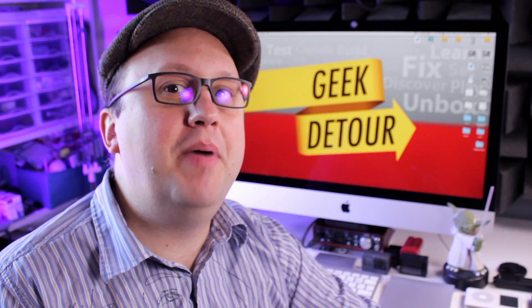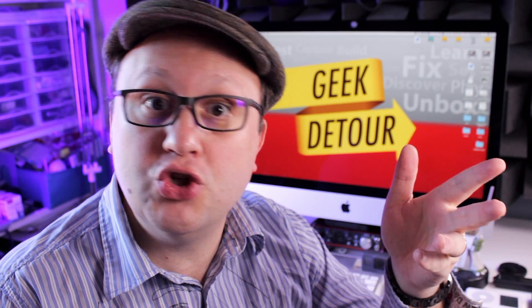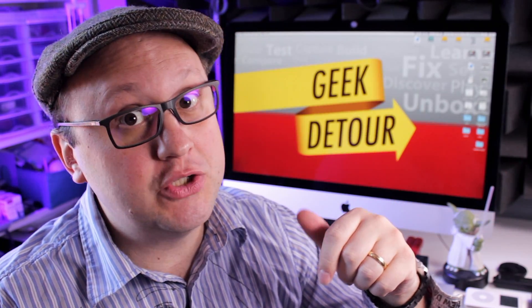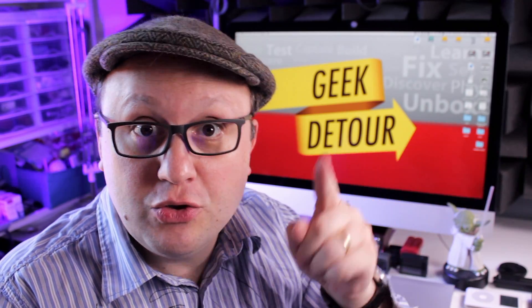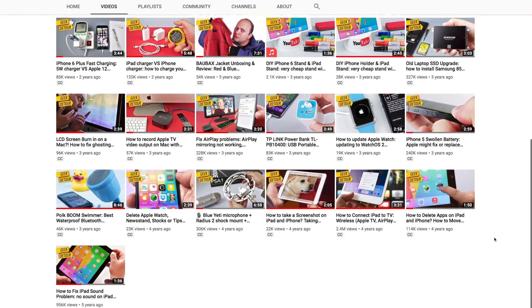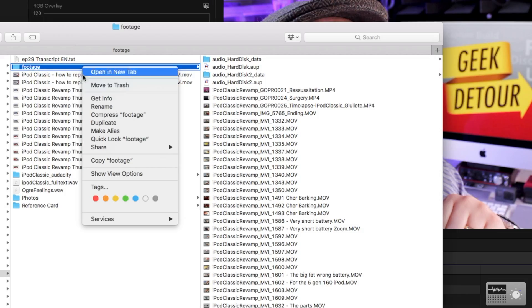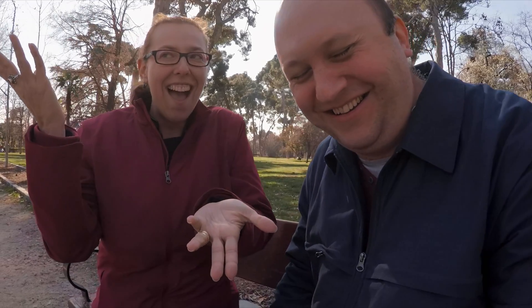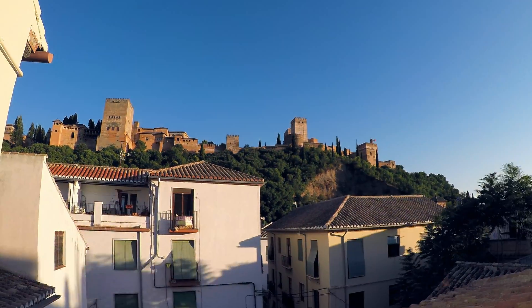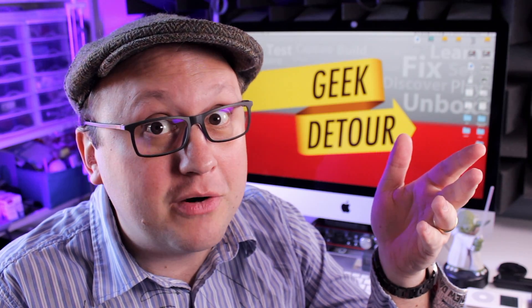When I bought mine, I paid extra for the quad-core i7, but the RAM was unchanged — 8 GB. And during these 5 years, 8 GB were enough for me. Every video on my channel so far was edited in Final Cut Pro with only 8 GB of RAM. But my projects are getting more complex with bigger files, and some footage is now shot in 2.7K or even 4K. So I wondered if more memory will make Final Cut faster or better somehow.